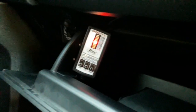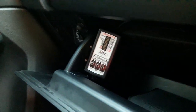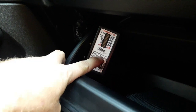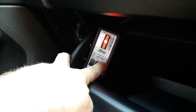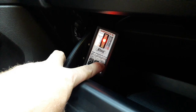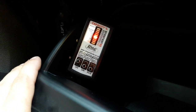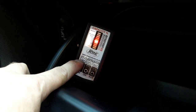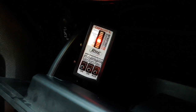Let's have a look quickly — climb in and I'll show you how this works. I'm going to switch off everything as it would be installed. When I switch on the MON — that's the monitor — it's only the display. The display can select either the main battery or the auxiliary battery below. The main battery is there; the auxiliary battery is a bit lower. If I switch on the charging system, nothing will happen — the system will just initiate and wait for the alternator to charge.